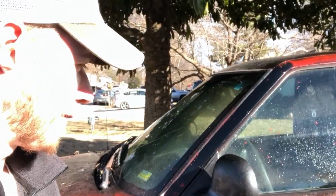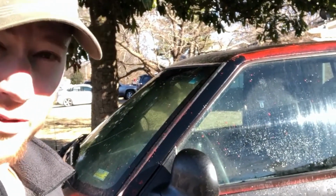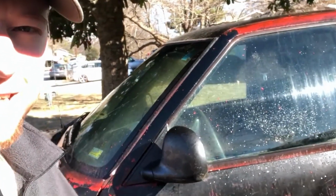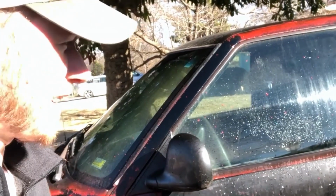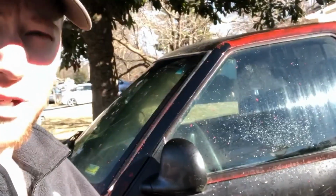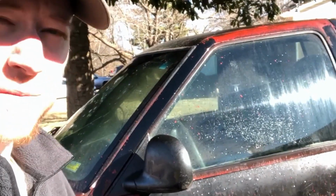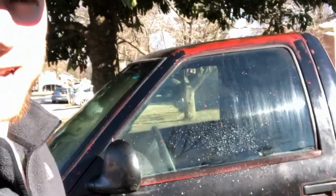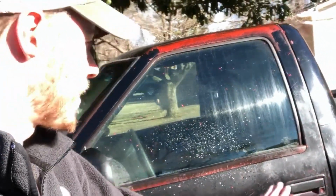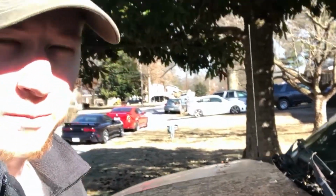But yeah, if you're gonna do Plasti Dip, go ahead and commit to it. Do it the right way. Don't do it like I did here. And the only two ways that I know of to really get it off good: some Goo Gone or WD-40, and then just start scraping. That, or what might have been even easier, is to go ahead and take another can of Plasti Dip, spray it on real thick. Then it probably would have peeled off in a sheet like it did up here, and that would have probably worked a whole lot smoother.